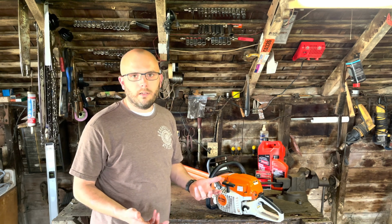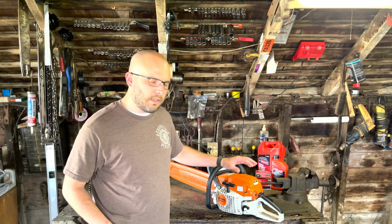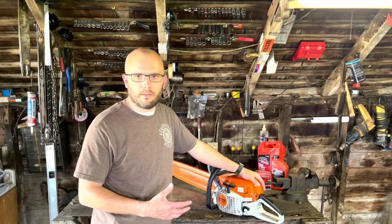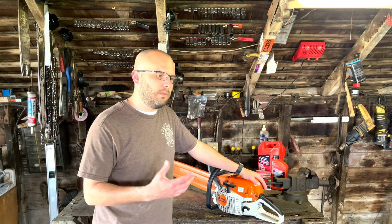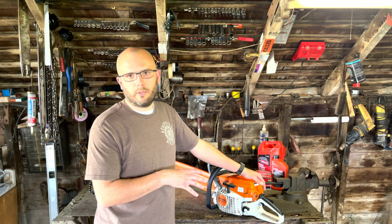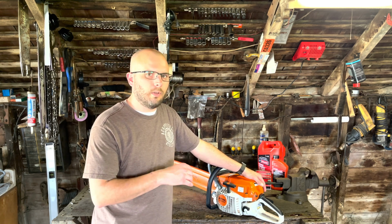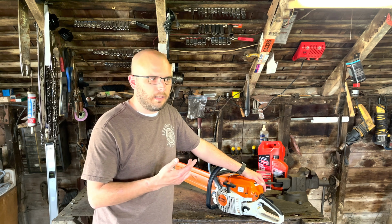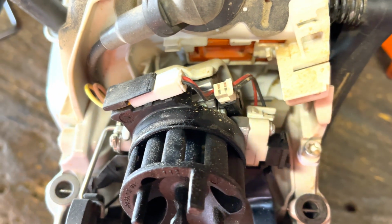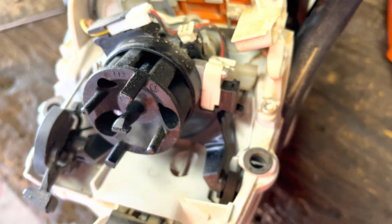So there's at least twice a year where you're tuning your saw to actually run in the conditions you're working in. So this saves you that trouble, because no matter what the conditions, it's got its sensors, it's detecting what the temperature is, what the air density is, what the oxygen content of the air is, and it's making those adjustments for you. I haven't delved too deeply into it, but I believe it's basically the same kind of setup with the high and low jets. It's just on linear actuators or electronic servos, whatever, in there, making the adjustments for you.